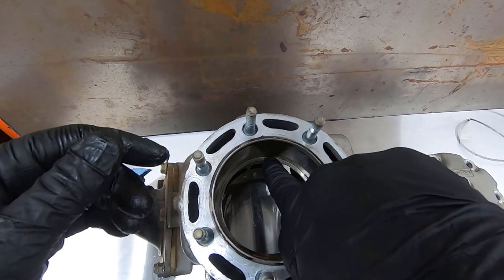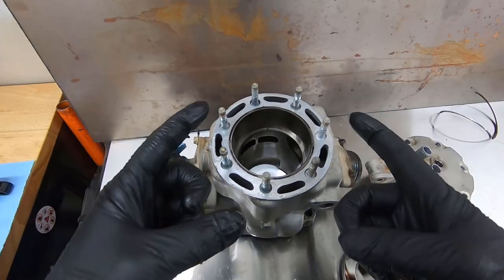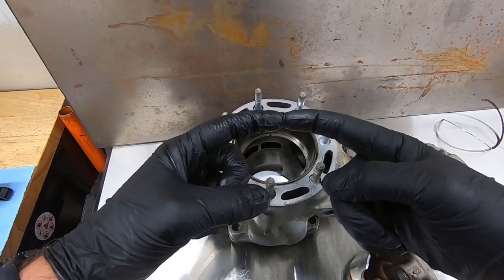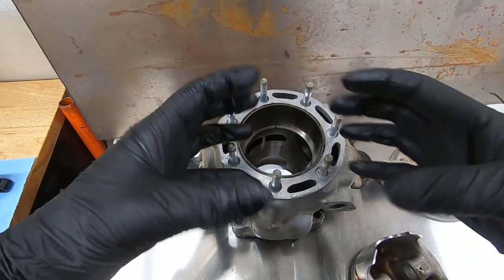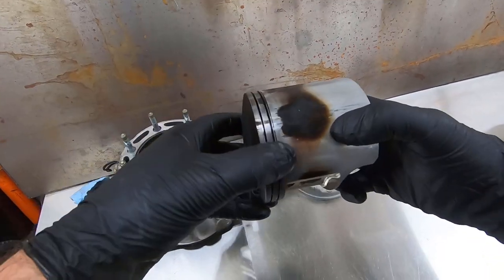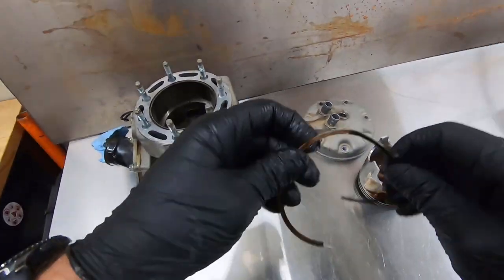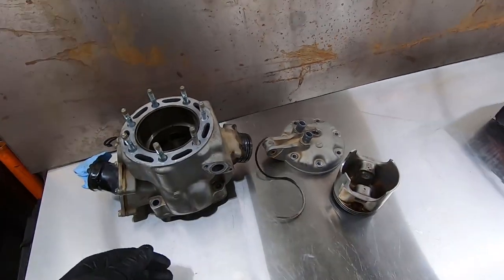Now, if there isn't enough gap while the part is cold, as the engine heats up and the ring expands, the ends come towards each other, and then they end up touching and they still need to expand. I don't know if that's what happened, but basically every two-stroke, you know, you need to measure the ring end gap. And so maybe, maybe not. I got impatient with this one, gave it a little bend, and see you later, babe.